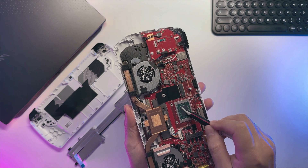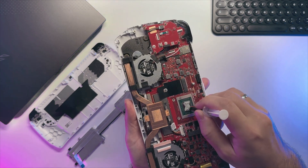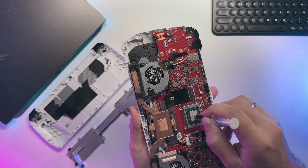Apex is something between PTM and standard paste. It is thick enough but not too thick, and thermal conductivity is great. I always cover my whole die and leave a bit in the middle to push out all trapped air when reassembling.